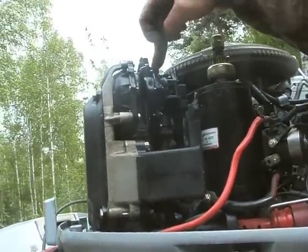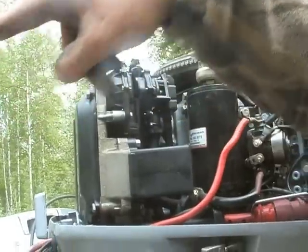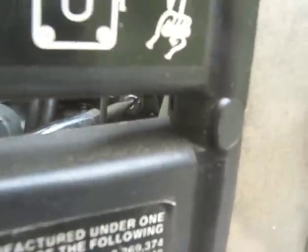But you can buy a regular fuel pump for like 100 bucks and just bypass the VRO. But now you've got mixed gas — 50 to one. Just pull that out, take that screw out, and then take this screw out right here — those are basically the drain for your carbs. I'll see you next time.